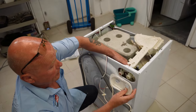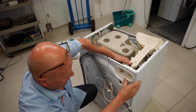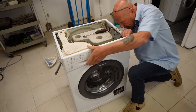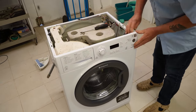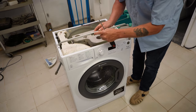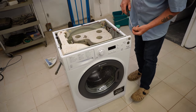The first thing I would do is mount the plastic back plate into location - this drops down first and then clips in, it will just snap fit. Now we can put the screws in. Reconnect the electrics to the panel first, making sure the plastic clips are clearly over the panel correctly. Once this is in, locate it so the soap drawer and everything is perfect. Now insert the steel bar - remember this can only go on one way because there's a recess lug for a plastic clip - and it goes under the lugs. Once it's in place, do up the screws.